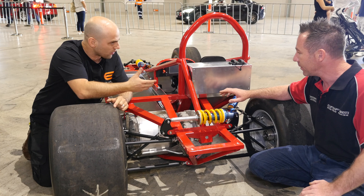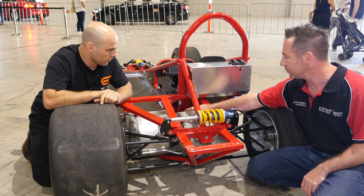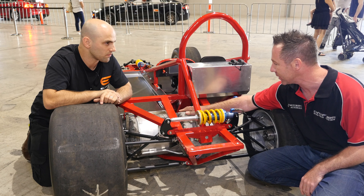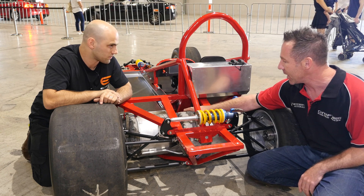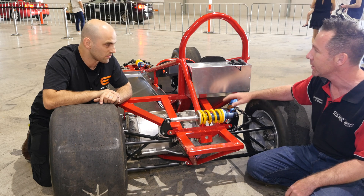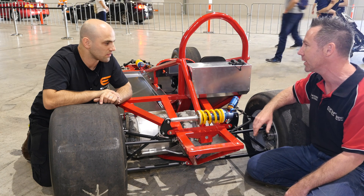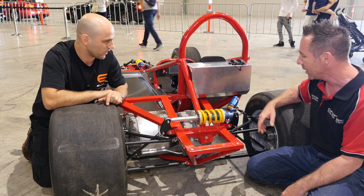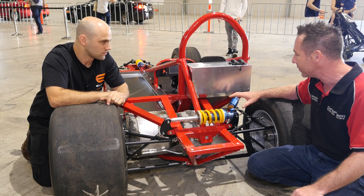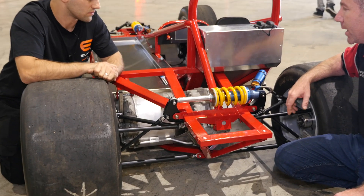It's flipped upside down. So basically what we had to do is flip it upside down and modify it. The initial Tesla picks up its oil from the bottom - what you'd call a sump - but it's just a tiny little reservoir. So the reality is we have to crack the case open, modify it, and run an external pump to be able to run it upside down. But in this scenario, having the weight behind the rear wheels would have been very bad for handling. So by moving the weight to the front and low, it means we've been able to kick up sooner with the diffuser to actually create more downforce, and it's moved the weight inside of the wheels for better handling.